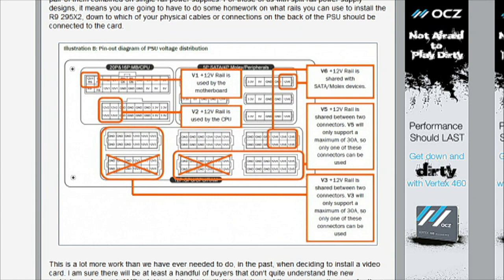And they're absolutely correct. If you look at power supply ratings, they're rated at up to 30 amps on single 12-volt rails — 60, 70, 80, 90 amps for the entire 12-volt configuration if you have single-rail or multi-rail. The problem AMD has created by having this card with only two 8-pin connectors is you now have to do a little more research on your power supply. Each 8-pin connector has to be able to provide 28 amps of power to the card individually. If you have a single-rail power supply, as long as the 12-volt rail can provide 50 or more amps, you'll be fine.